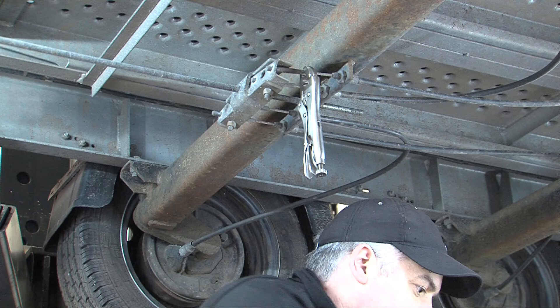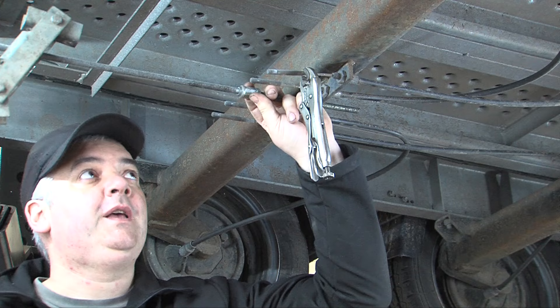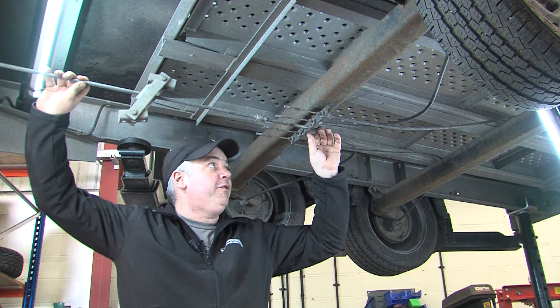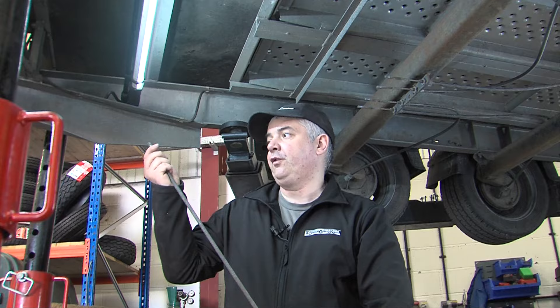The compensator can then be moved forwards and there's a locking nut. I've already cracked this so that we had movement on the coupling. This needs removing. To remove it on this particular trailer, the rod goes through there and there isn't enough movement, so I've already cracked the bolt on the front of the coupling. The rod can be unscrewed from the coupling and the nut on the front of the rod can be removed.